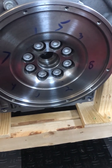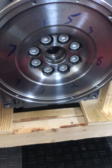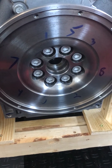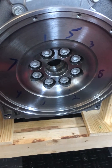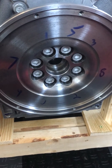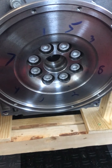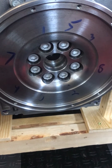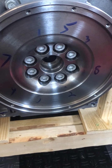To me, that's really not an ideal solution — it may work, but I did speak to the transmission shop and a fellow builder who are adamant that's not the best approach. So I'm sending my flywheel down to the transmission shop. They're going to bore out that hole and create a small shim band — probably about five one-hundredths of an inch — and that will enable this bearing to press in and be held very securely into the flywheel.